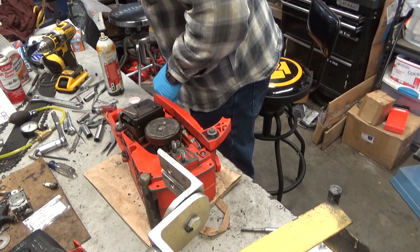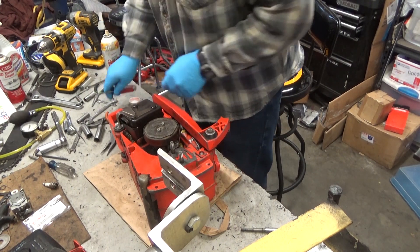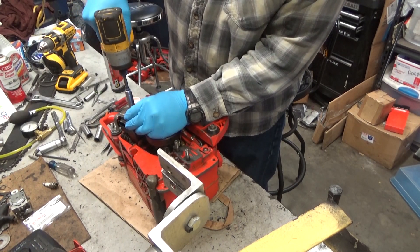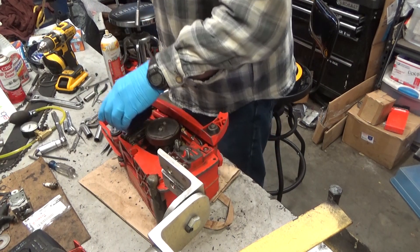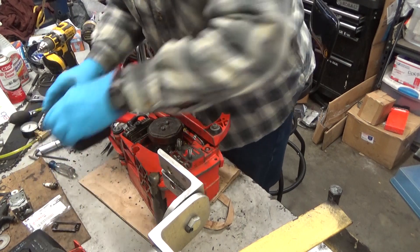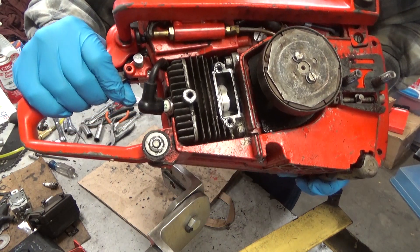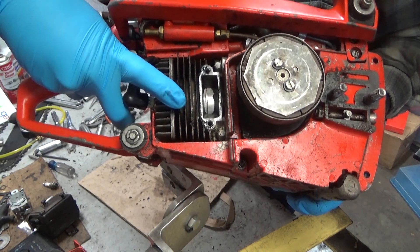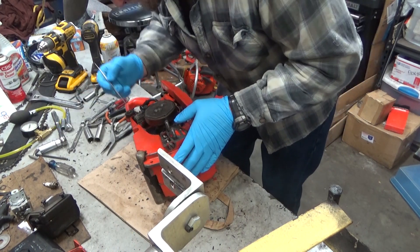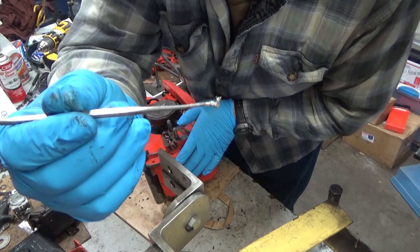Let's get this muffler off. Piston looks good, at least what we can see of it. But I want to point something out — you can see the piston looks good, but look at all that corrosion down there below that mounting, on the bottom of the cylinder. I'm actually questioning whether it's corrosion — it's some sort of a greasy, oily thing. That's something I don't normally see on one of these.